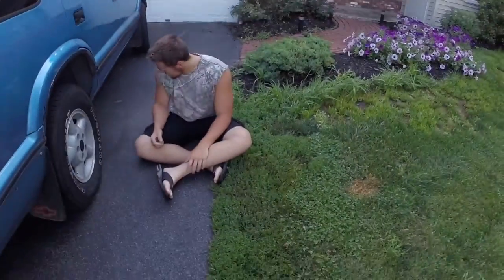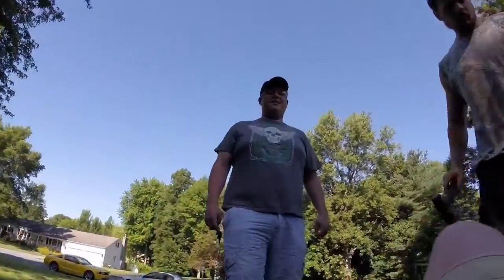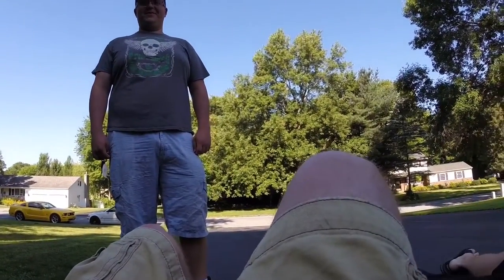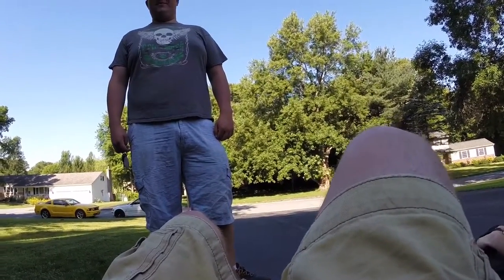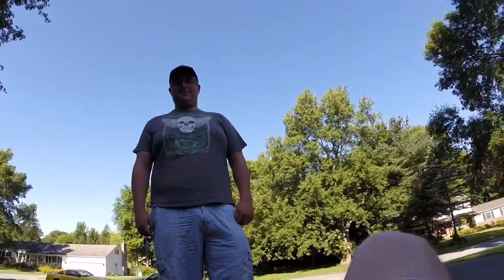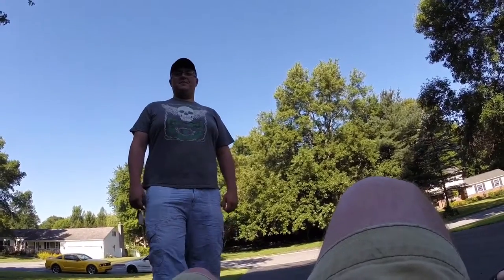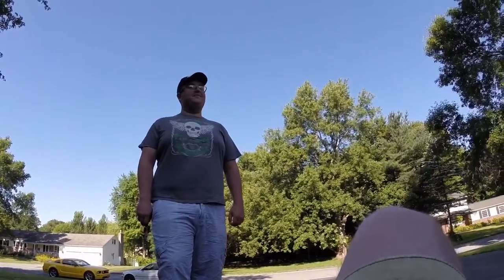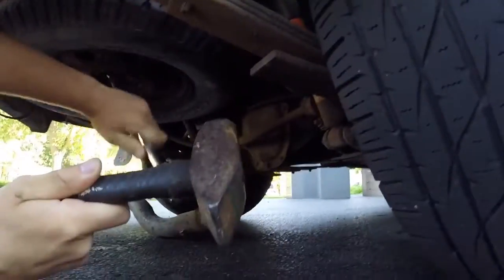The throttle blade on this car was like a regular throttle body blade, but when you opened it on the underside there was a big baffle that literally restricted almost half the throttle body. Apparently it was just there for the V6 to chill out with the airflow. All you had to do is take the blade out and cut the thing off — it was like porting the throttle body by like 16 millimeters. Are you using your broken breaker bar as like a turning tool?